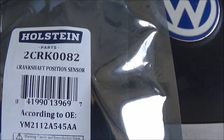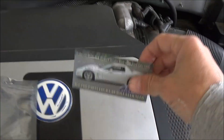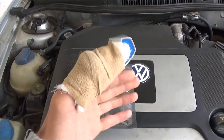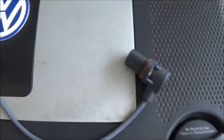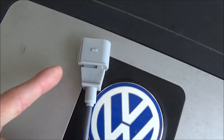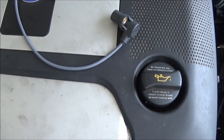I have the new crankshaft position sensor — we got it from Rock Auto because they're usually the cheapest. When I started this project, I didn't have stitches in my thumb, so it's going to be a lot harder to put everything back together, but we're going to try. What we're going to do is put this connection in on the dipstick where it holds it, and then you'll be able to plug the plug in from the top, and then we just have to put the sensor in.